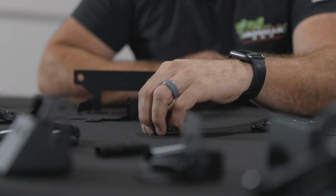I'll rotate that over. Over here on this side, we'll just continue the cut right through there. This cut goes here, right through there, and back over the top. And I think if we're careful, we can make this look pretty clean. Now, grab your tool of choice, whether that's a jigsaw or cut-off disc. I'm actually going to use my little DeWalt multi-tool, and we will get that cut out. By the way, I'm cutting inside of my cut lines because you can always take more off if you need to. So I'm going to cut a little bit narrow, then I can always clean it up.